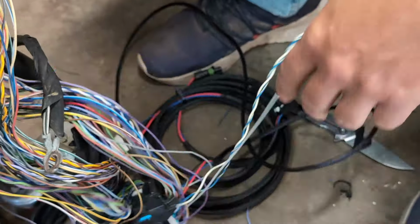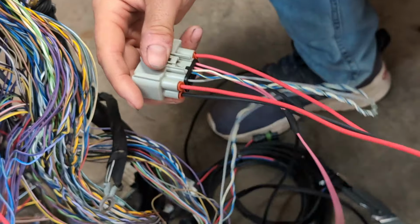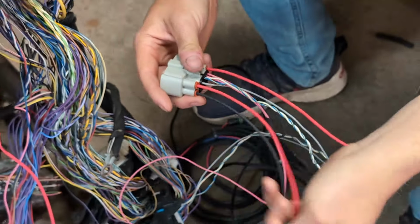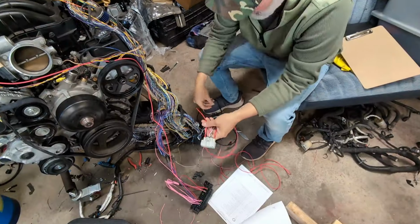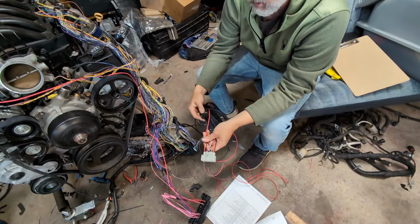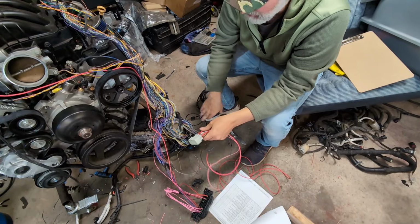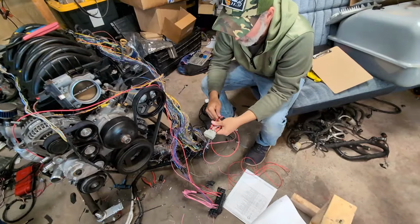And then your other wires right here, on this side, spot one and the black one below it, that's your power and ground input. Then these two go to your fuel pump. So if you order the whole setup from us, it'll come with a connector, and this will all plug in. And it'll come with the fuel sender wires that you can run to your ECU. Then your ECU knows your fuel level, and Dakota Digital gauges can read fuel level off the network.